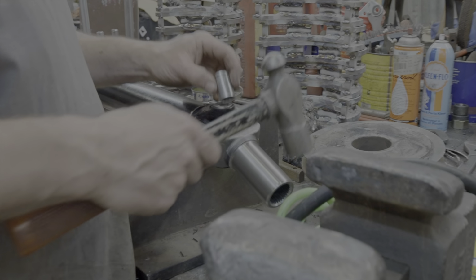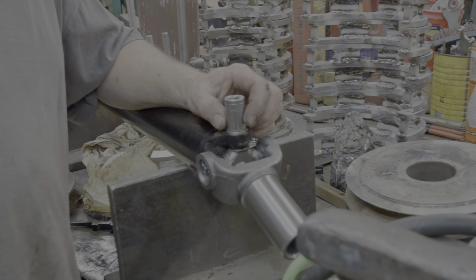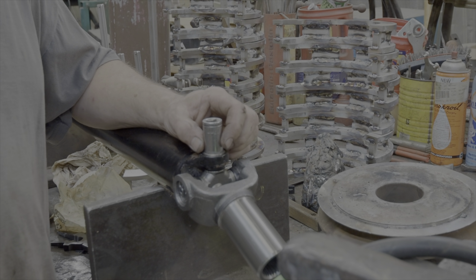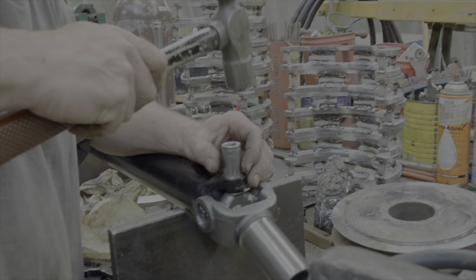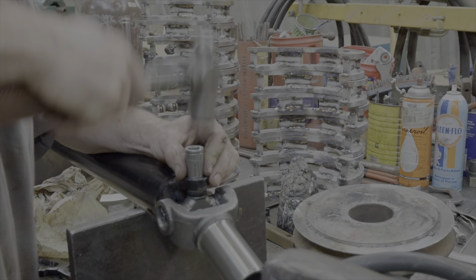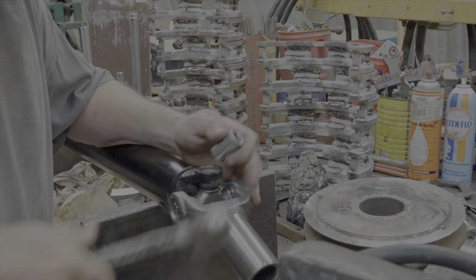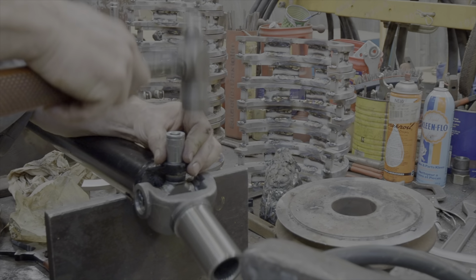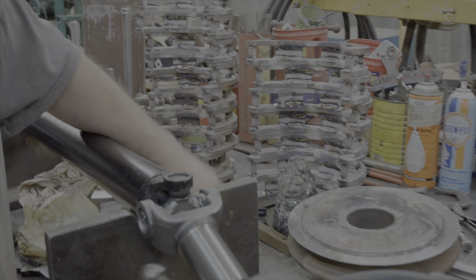We put a lot of length in that car with that adapter and that overdrive unit. The worst part was cutting the brace off. You have to trim the body brace out under the tunnel, and that's thick steel and there's no room to work. That took us, what, 2.5 hours last night? Well, a couple hours, yeah. Better than 2.5 days. She was side grinder city. I looked like a black man. My arms are black, the top of my head totally black.